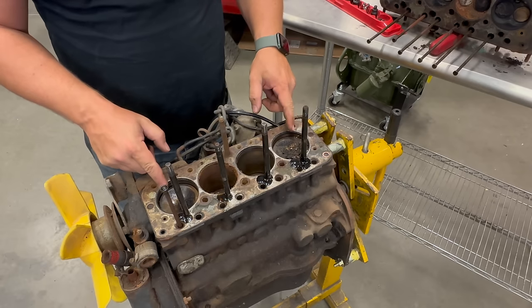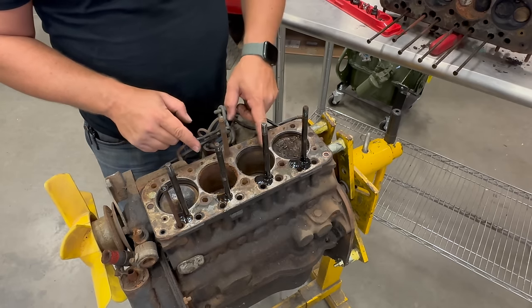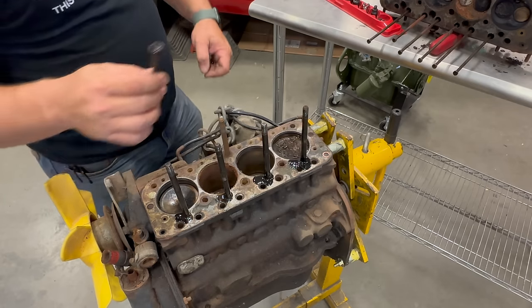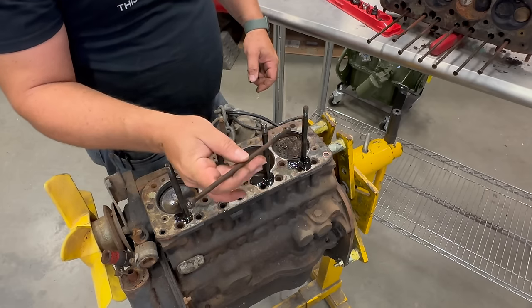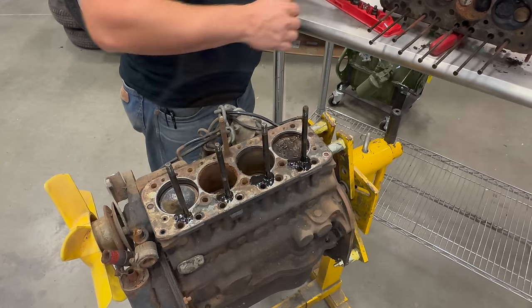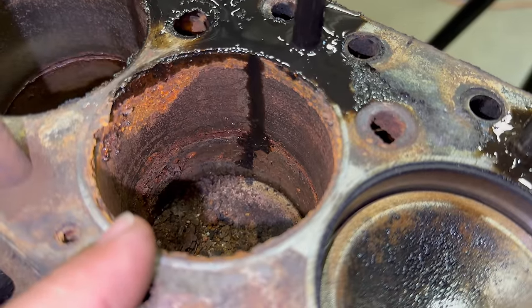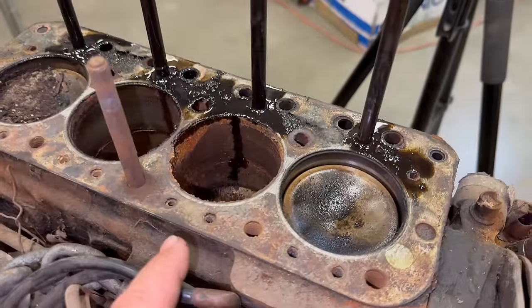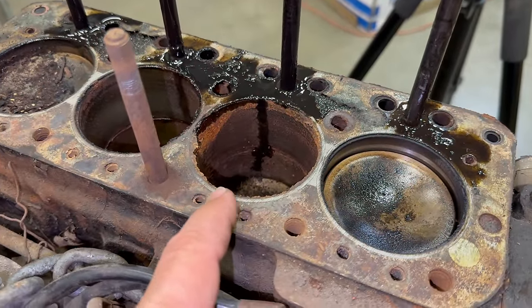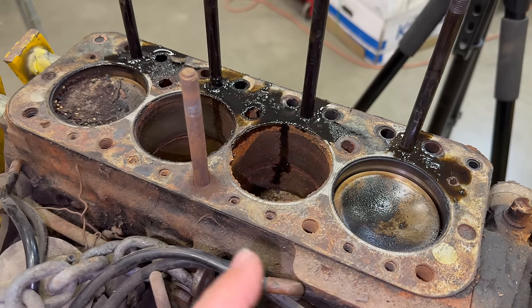At first glance two cylinders look alright — the pistons were up and nothing really got in there. Some debris fell down but that's not a big deal. This cylinder is pretty rusty and this one is a little bit better. I'm going to put the push rods back in the head before I lose track of the order they were in. These are so rusty I won't be using them again, but it's still good practice. Cylinder three is quite rusty, cylinder four not as bad. Once everything is stripped, we'll get this machined — they'll bore out the rusty cylinder to determine how far they need to go, and that will determine what bore size all four cylinders get bored to.